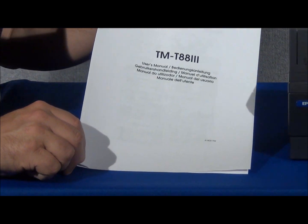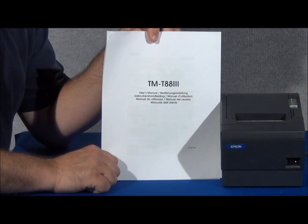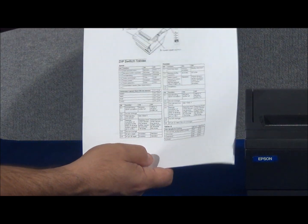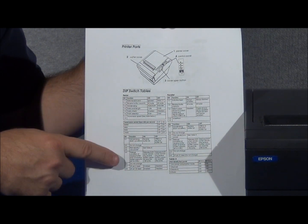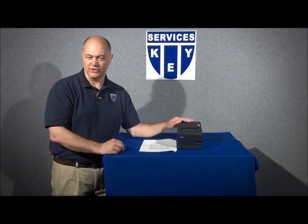This is the quick setup manual I mentioned just a moment ago. We have much more detailed manuals available, but this manual ships with every printer purchased or repaired by Keyservices. On page two of this manual, you'll notice the settings for Bank 1 and Bank 2. We always suggest that when you receive a printer back into your restaurant, you set the printer up to match the bank settings — left and right — of an existing printer in your restaurant that is already communicating.